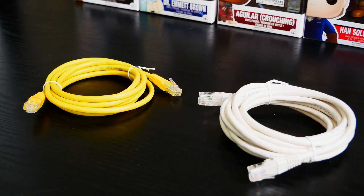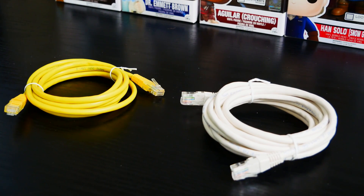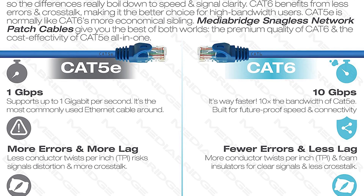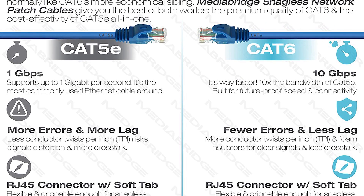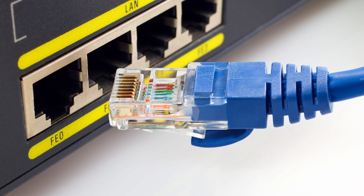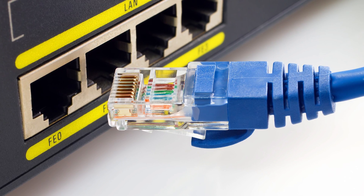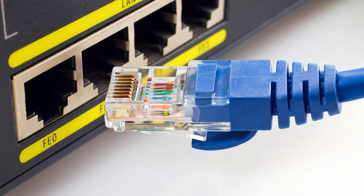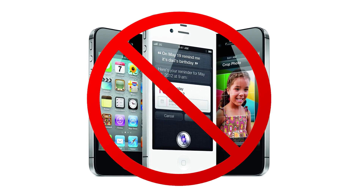To wrap up the intro, I'm going to essentially disable the wireless radio capabilities on the Verizon combo box and replace them with my own personal router. This process does begin with a little physical prep, as we're going to need a few extra ethernet cables. Please use Cat 5e or Cat 6, as they allow for up to 1 gigabit of theoretical throughput with Cat 5e, and Cat 6 allows up to 10 gigabits. Before we get down to business, you will need a computer hardwired to the modem/router combo and then wired to your third-party router. Using only wireless devices will not work.